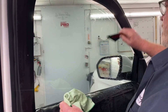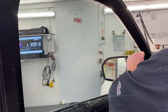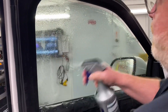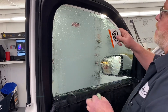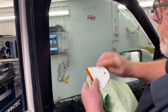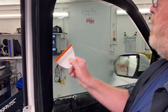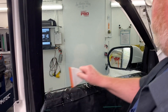If I was a speed tinter, I would be flying through this and show you nothing other than how fast I am — a job that can be completed just as quick in an almost perfect manner. This is a link tool with a 79 durometer judge blade in it. I like to squeegee and cover the whole glass like this, pulling all the water down to the bottom.